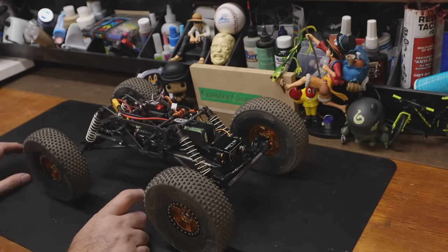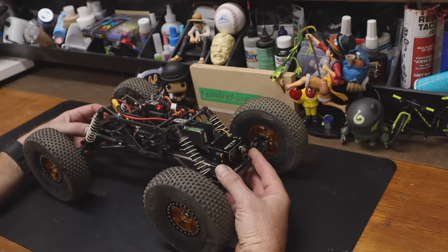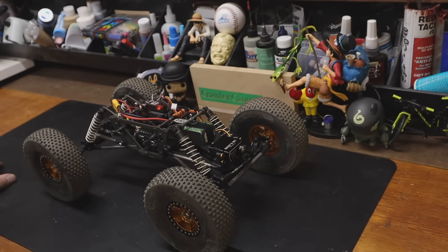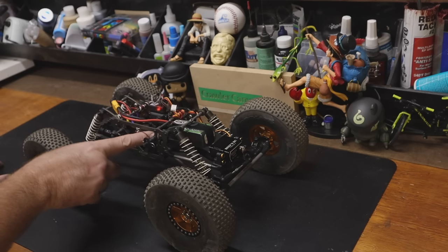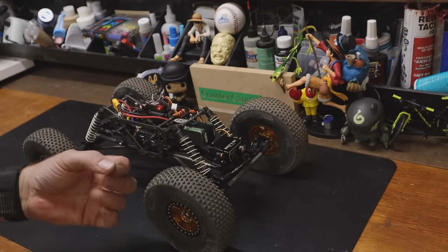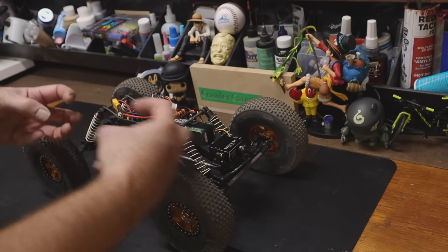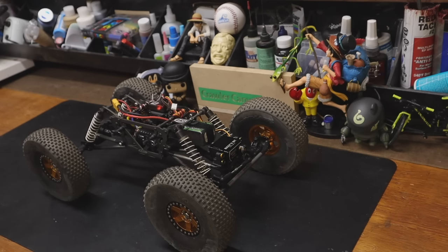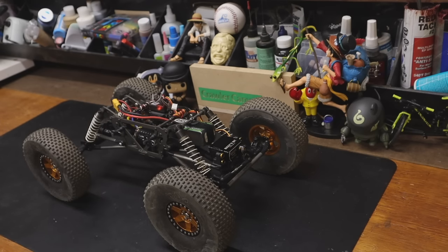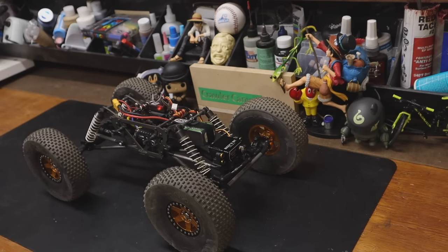It's that worm drive can only be propelled by the gearbox. So all of the gear reduction is in the axles. Best as I can tell, there is no gear reduction in the gearbox. It goes from gear to an intermediate gear to what would be the spur, and the spur is tiny. It might have 20 teeth. Goes inside the box to another gear, which drives an output gear that has the two outputs on it. So as best as I can tell, rotating this gear and watching the output shafts, we might have like 1.2 to 1, but it looks like 1 to 1. So all of the gear reduction is in the worm drives at the axles.